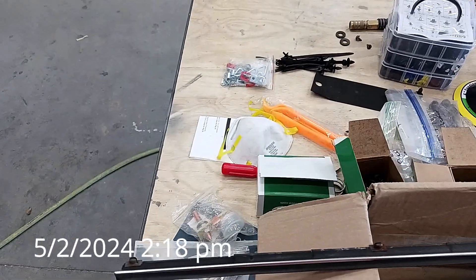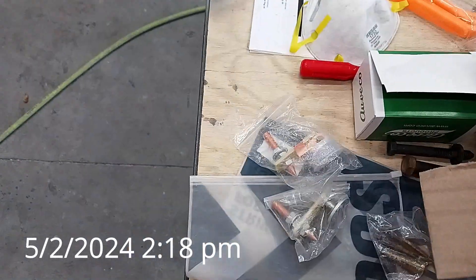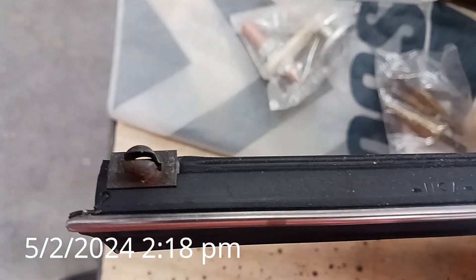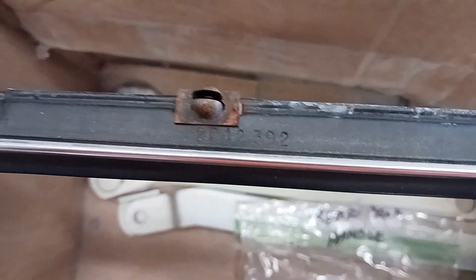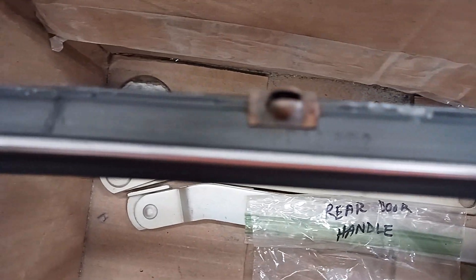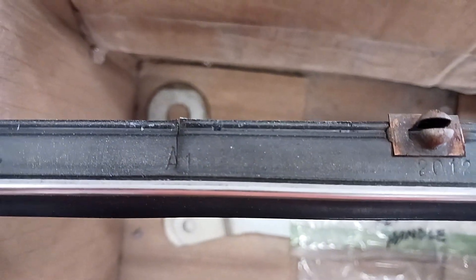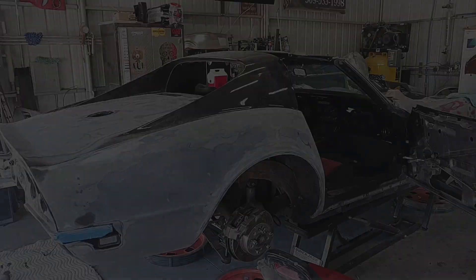On those felt moldings - I just wanted to show you this - they have these little bumps that go into a hole and lock. That's why you have to grip them to pull them out of those holes and get them out of the car. Just grip and pull with finger strength and you'll get them out.